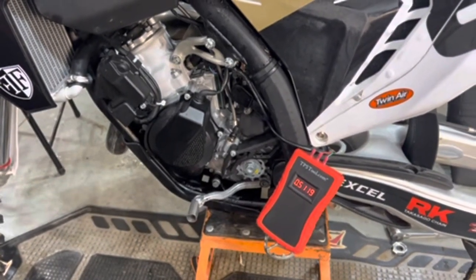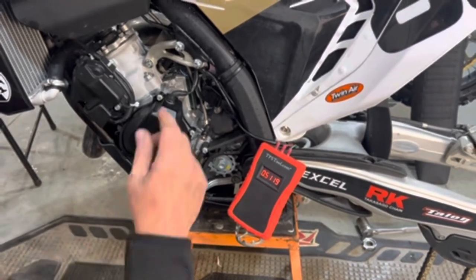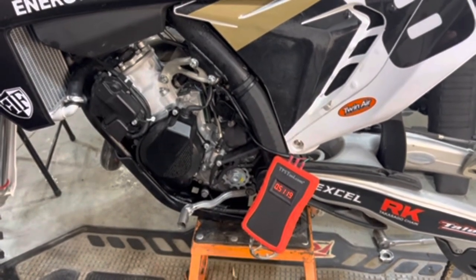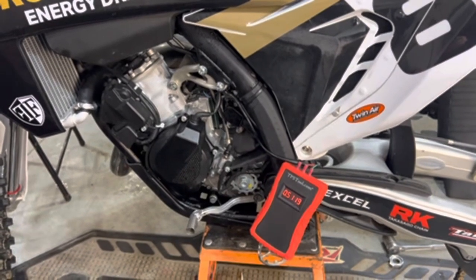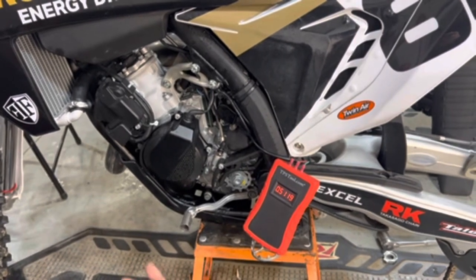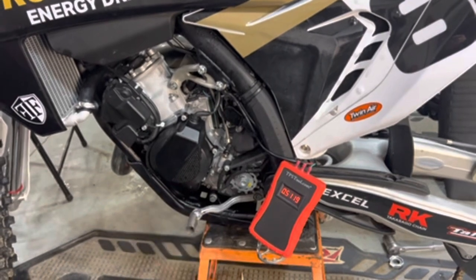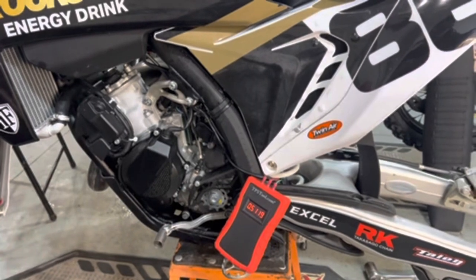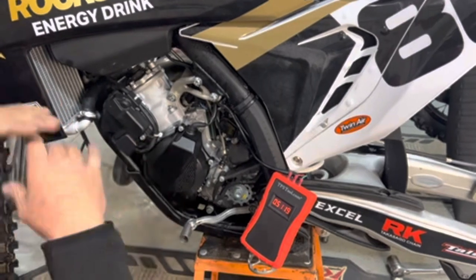You've achieved essentially where you were for your starting point. That's going to change if you want your bike to idle higher — go in with the idle screw and it'll make the idle go up. As for the yellow idle, it was only pulled out four clicks, so we put those four clicks back in. You can feel it's like a small detent inside — just click, click, click, click — one, two, three, four. Basically, this thing is now set to 0.4000 with nothing else connected.